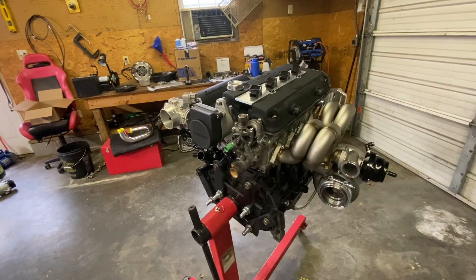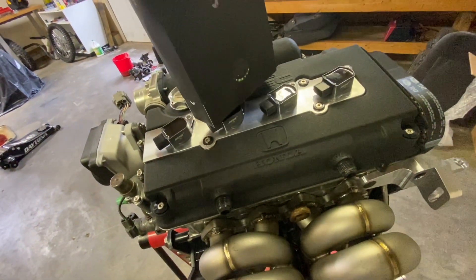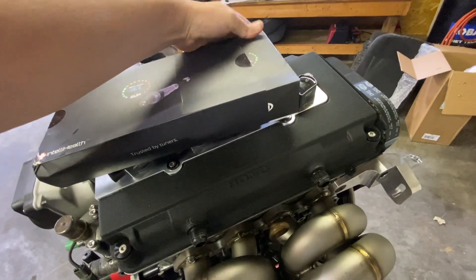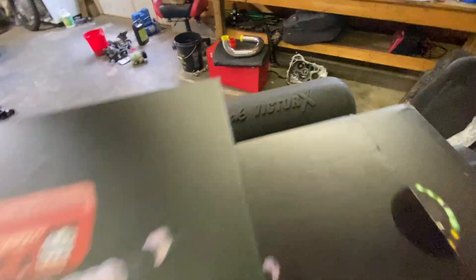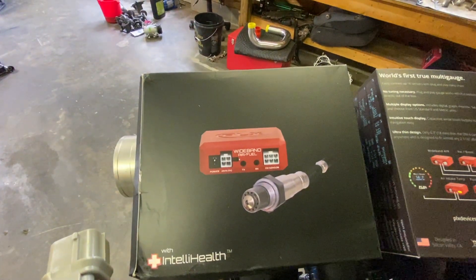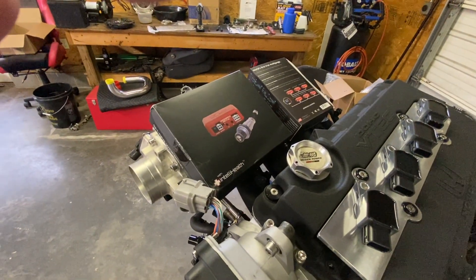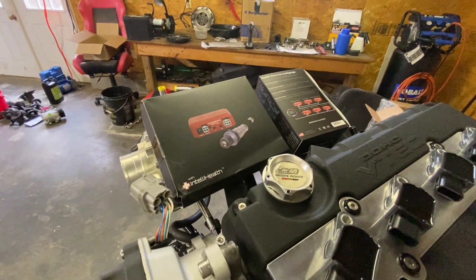Let's check out these electronics — we've got a wideband here. What we did was a PLX wideband. This has got a little bit more than just a wideband in the box. This setup is going to go nicely in the bezel pod that goes around the speedometer. We have our controller box and our gauge box — between the two, you have a display and then your controller box, which we'll wire into the ECU so we can data log through the computer. I'm really a big fan of the AEM — they're super simple — but from what I've read, the PLX is as well, so we're going to give it a shot.